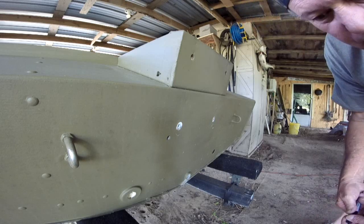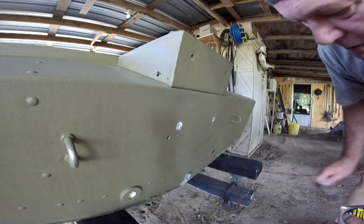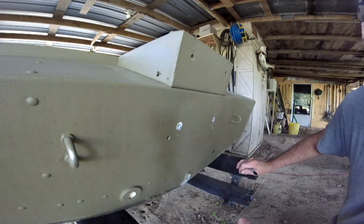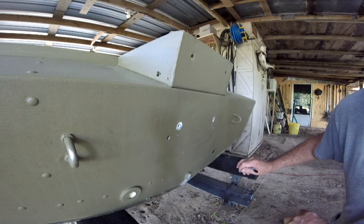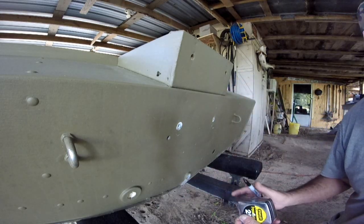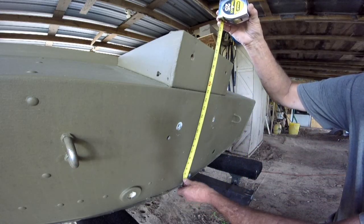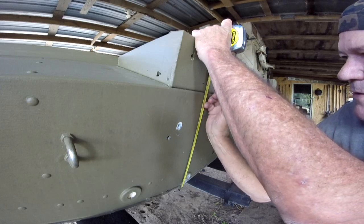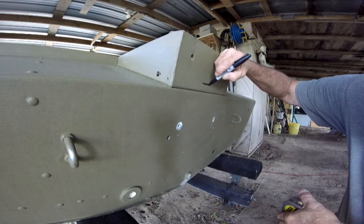Let me show you what's got to happen here. Around here they call them short shanks because it's a short shank motor. It measures 18 inches on the motor. On the old boat I adjusted it several times and finally got it right - the levels, the cavitation plate - all perfect at 16 inches. Now what I've got is 20 inches, a little bit more than 20. So let me mark this - the top of the motor throat has got to go right there.